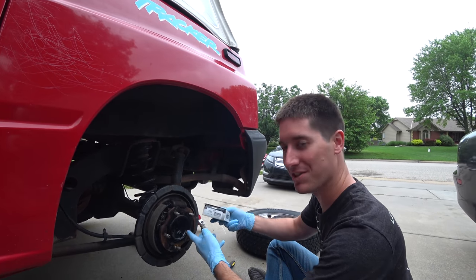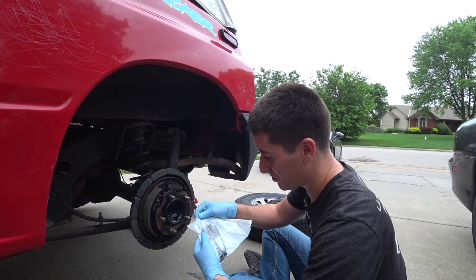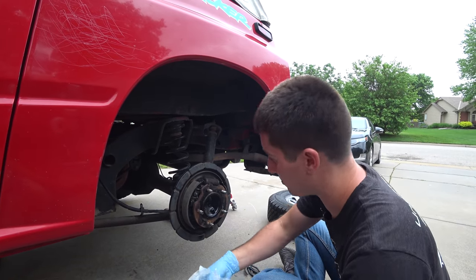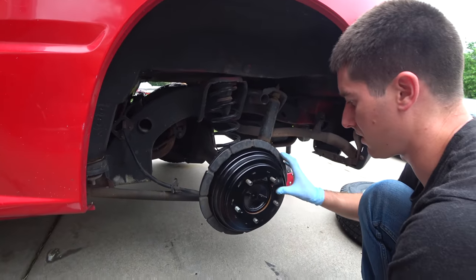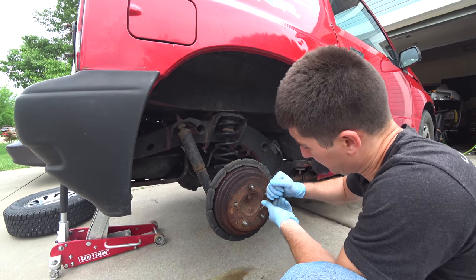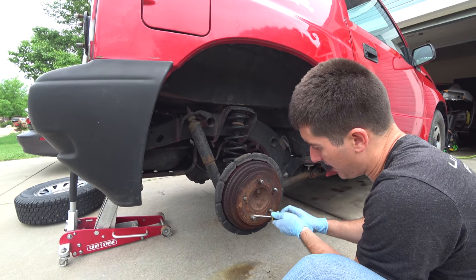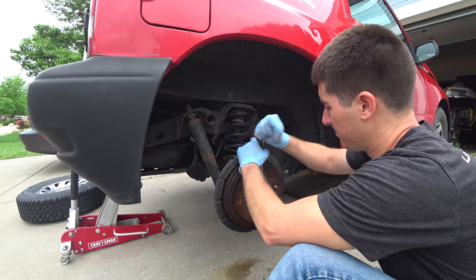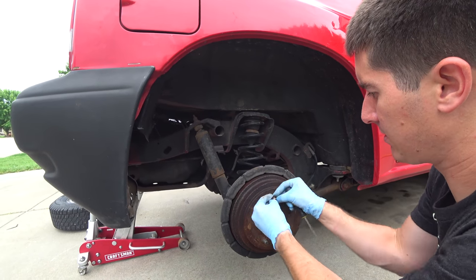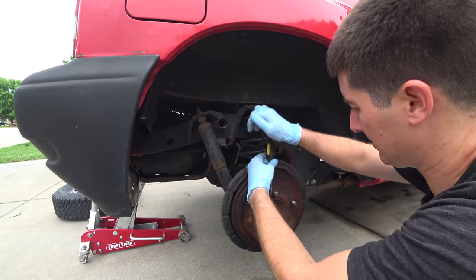Now we are back with the missing parts we needed from O'Reilly's. We've got one of everything brand new — all the retainers, all the springs, the clip. Let's get this apart for the second time and replace all of these parts. I kind of want to take the other side apart first. Try and clear out any rust — it's going to hold this thing on. If you guys have these clips on here, you're going to have to either tap them back and then get behind them and pry them off like this. You can get them off with pliers, or unscrew them while pulling at the same time, but it's probably easier to just knock them off.